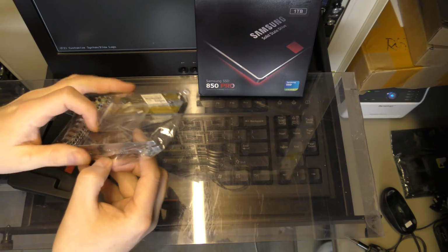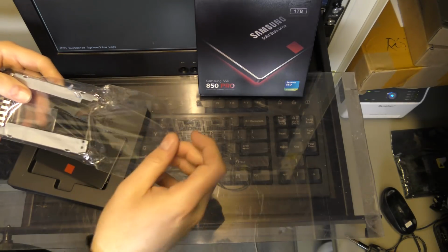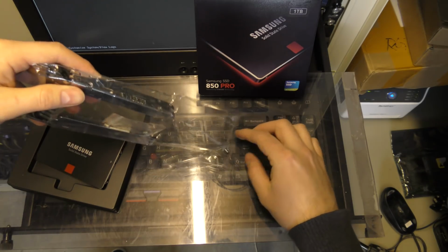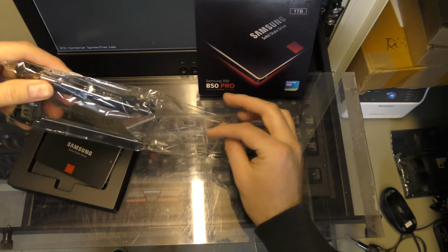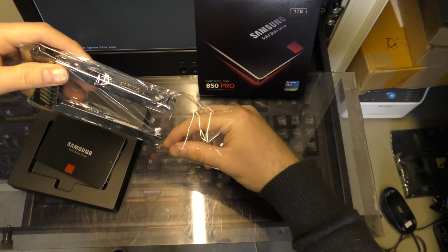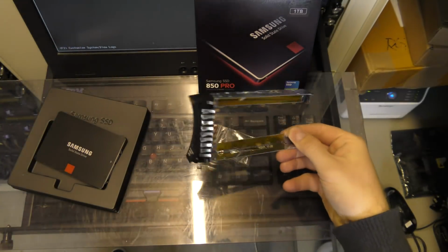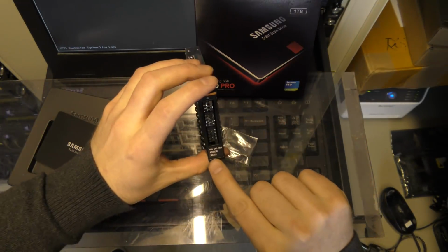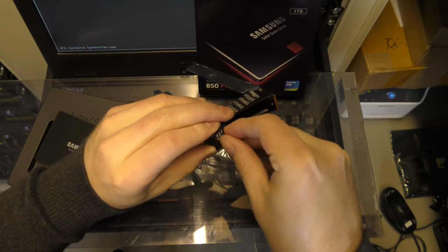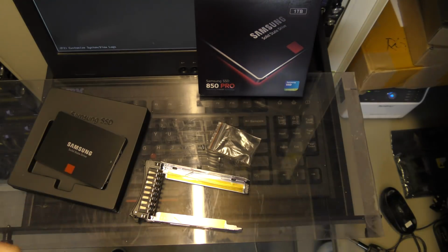These are trays that I bought out of China. They are refurbished trays for the Lenovo/IBM servers, and they have 4 screws in there, and they used to be in that little bag. Now they're all over the place, so I have to be a little bit careful. There's still 1 screw in that bag. But very nicely wrapped. And this is a tray that has come out of a 300 gigabyte SAS drive. So we will remove that label so that we don't get confused. There. And we will mount these. These are regular Phillips head screws.